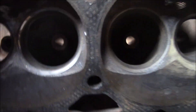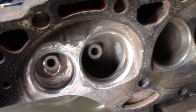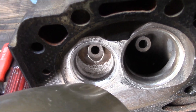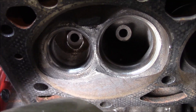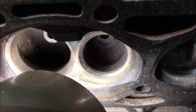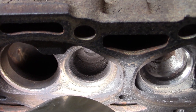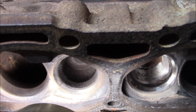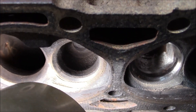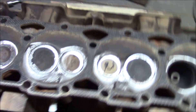So here I'm getting another angle. Let's see a little more of what I've done. A few small spots I fixed here and there, but I didn't want to go crazy. I don't want to put a lot of time on these cylinder heads. The exhaust ports need a little more attention — just running your finger through them, they were crazy rough, like 30-grit sandpaper — all carbon and crusty casting flash, rusty underneath. So it was almost mandatory for me to smooth them out. When your exhaust ports are rougher than the intake ports, that's not good. I'm over here on this head and I've started on the chambers.